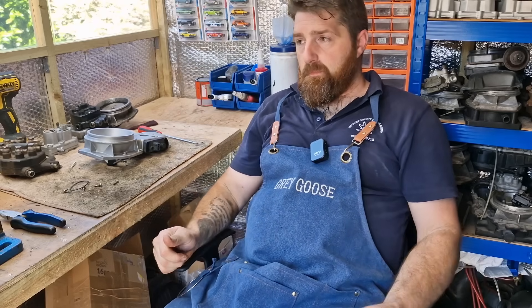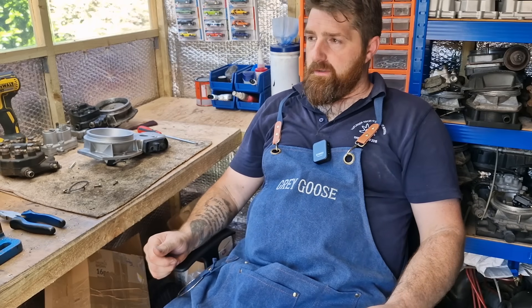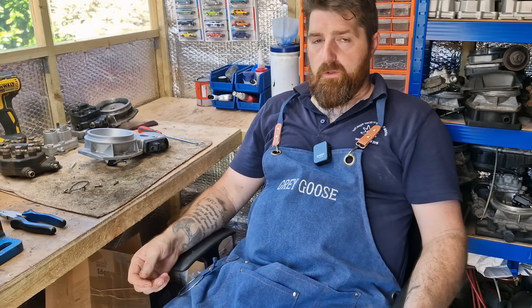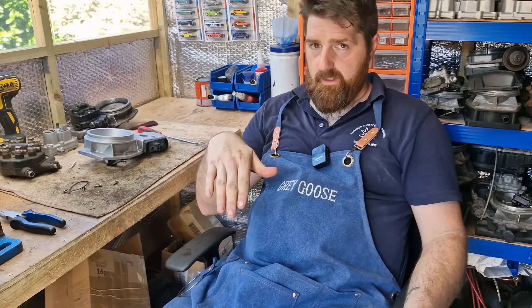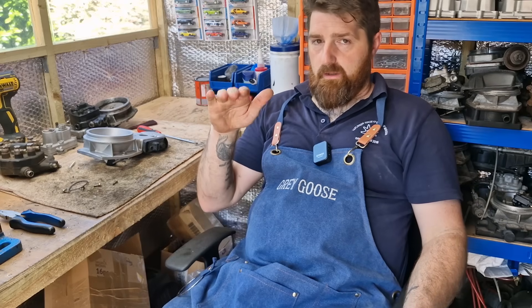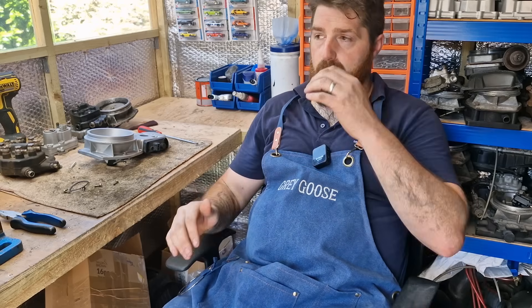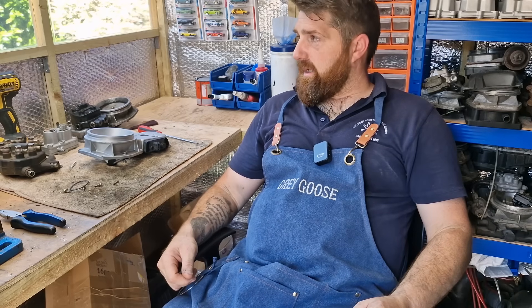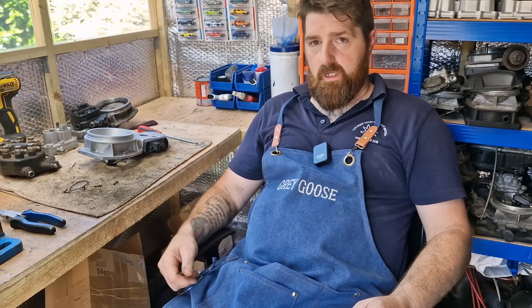Hopefully that answers any questions and shows you how to do this and test it. You might ask why the air plate drifts — it only rests on a little metal spring. Over a hundred thousand miles that spring can soften, so it needs adjustment to bring the air plate back where it should be. Thanks for watching — if you can click subscribe, I'm going to get a cold drink and hide in the shade because it's very warm. See you again, bye.